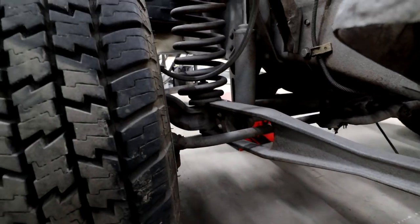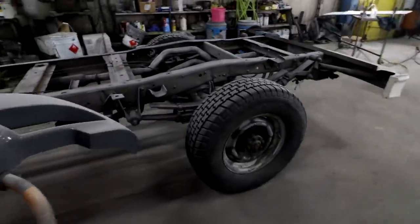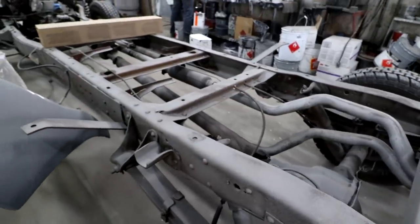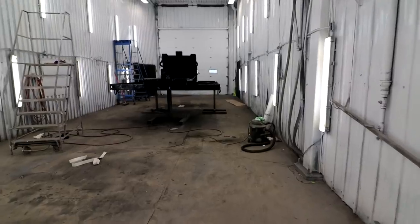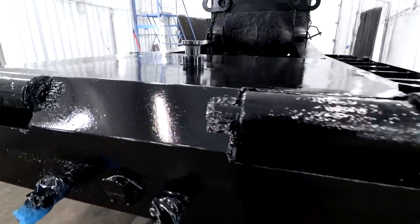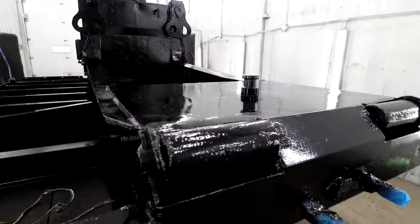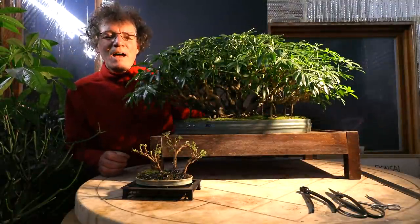The other area is these front cab mounts — the better one still will probably need a plate welded on top because there's likely rust underneath that rubber bushing. On the other side there is a giant hole where the bushing used to be — you can't buy these brackets, so there'll be some fabrication work to reinforce and make that solid. Everything came out really nice — the suspension, springs, all nicely blasted. In the spray booth there's a trailer frame that's been painted with epoxy primer and top coat — quite a thick paint job. That's what the truck frame will get painted, and it'll look quite nice when done. Very exciting! That's all for today, I'm Nigel Saunders, thanks for joining me in the Bonsai Zone.